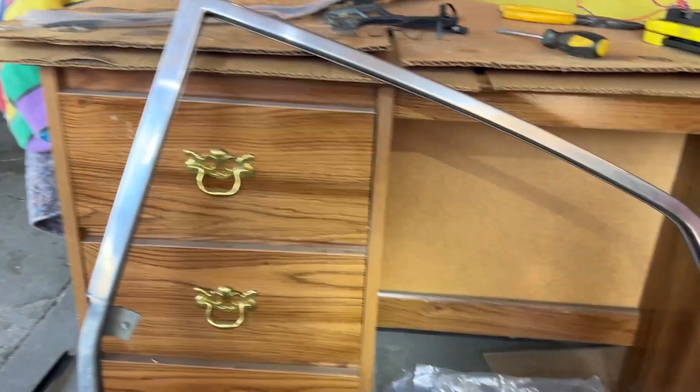Just like we did with the quarter window, I believe it still has some pieces of old weather stripping on it, so I'm going to go ahead and pry them out, take everything out of the channel, and clean it out a little bit to prepare it for the new weather stripping. All right, so now with the rail cleaned out from the old weather stripping...